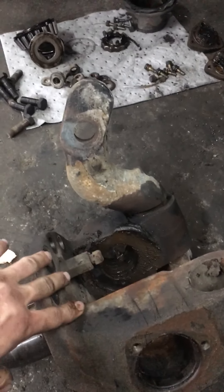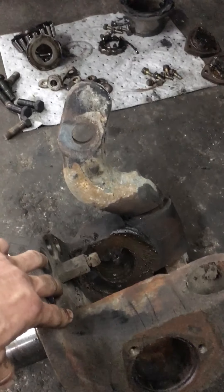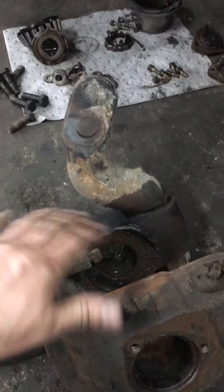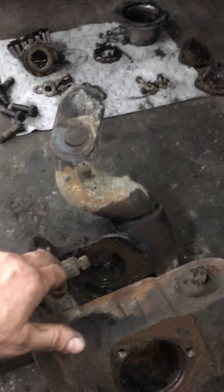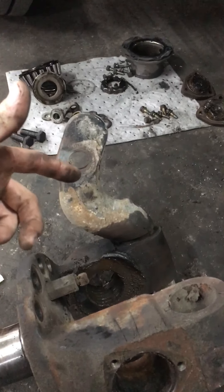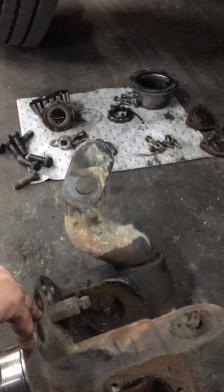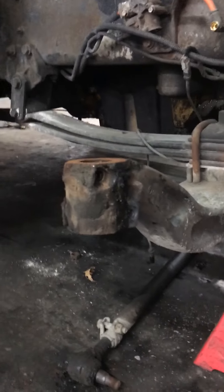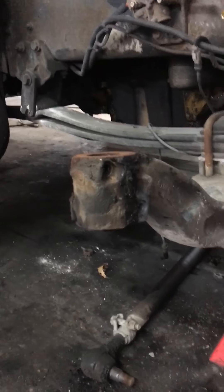So the next video you guys see, I'm going to go ahead and have the bushings pressed in — I'll do it myself here. I have aftermarket bushings that are already fit to the kingpin, so make sure you get that clarified with your parts guy. After I get that, I'll show you guys how I got it set back up on the axle. In the next video, hopefully if I can get it done today, I will show you guys an almost-finished product with both spindles set back on and re-shimmed, and give you guys some more information on how I did that. All right, this is Sean — I'll see you guys here in a bit.